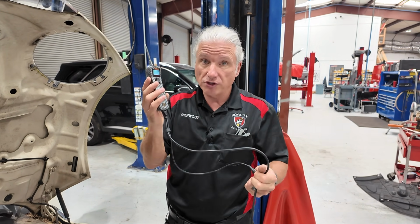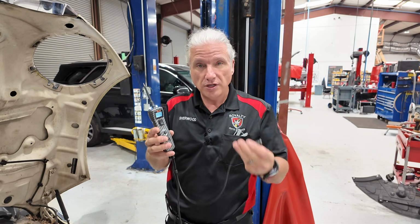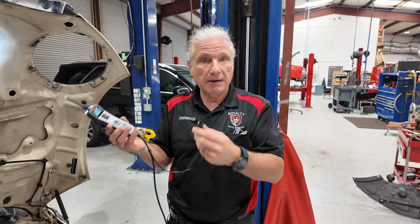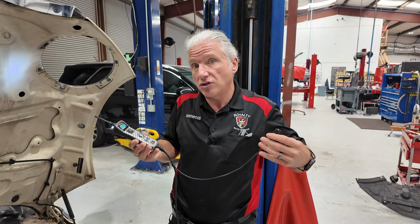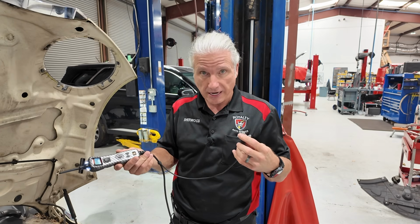As long as our cabling and everything is good, which you should be checking periodically, believe me, this is a good ground. So now if I'm in the car and I need to do some testing, maybe I've got my scope hooked up inside the car, or maybe where the lead's not long, I don't have my extra long leads on it. I've got this thing, boom, I can hook my scope right here and I'm straight to the battery, right?